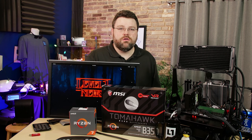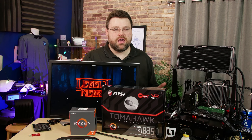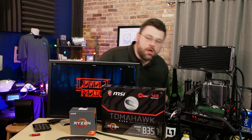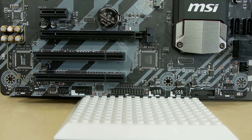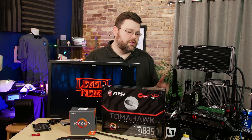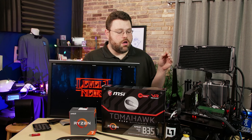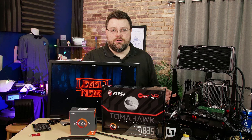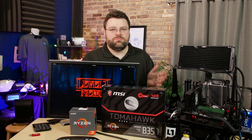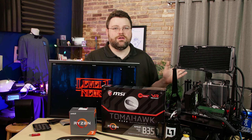The motherboard features two USB 3.0 front panel headers — technically USB 3.1 Gen 1, the 5-gigabit standard — one on the front and one on the bottom. Just below the SATA ports, there's another 4-pin fan header. Then you get your front panel connectors, two more USB 2.0 headers for extra USB 2 or front panel USB 2. There's also a blast from the past: an LPT port — a line printer port — it doesn't come with a cable but all the hardware is there. There's also a serial header for a real RS-232 serial and an ECP-EPP parallel port if you desire. And of course there's an RGB header, because everybody and their brother has RGB functionality.